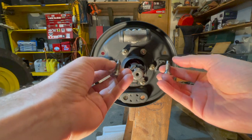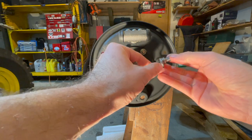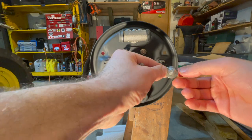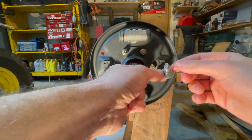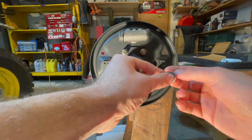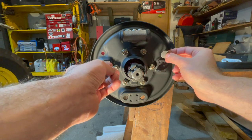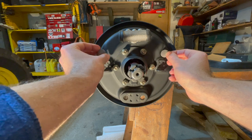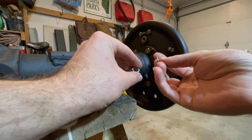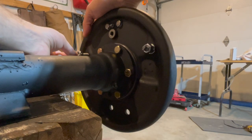The next step is to install the two upper eccentrics through the two upper holes on the brake backing plate. One key note: the eccentric is not exactly centered with the cam — there's a short point at the top and a longer point at the bottom. You want the shorter point towards the outside or towards the brake shoe on both sides. Install it with threads facing inwards towards the axle and the smaller point facing out on both sides. This allows the brake shoes to install easier and gives a good starting point for brake pad adjustments. On the backside, put on your 3/8 lock washer and 3/8 fine thread nut; repeat on the other side. Only hand tighten these two nuts as they will have to be adjusted later.